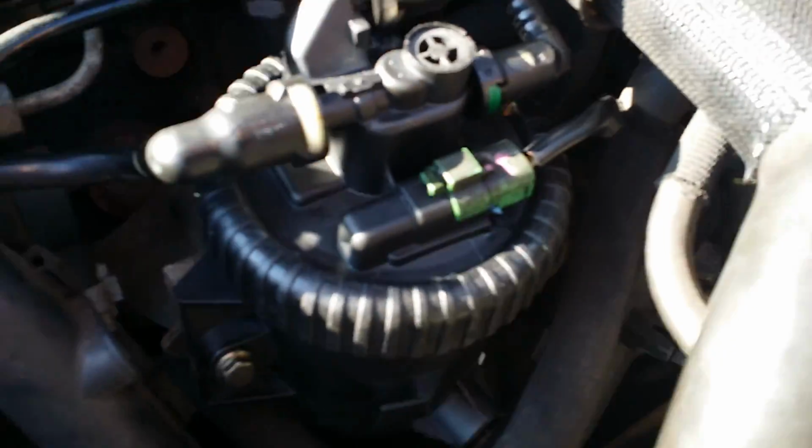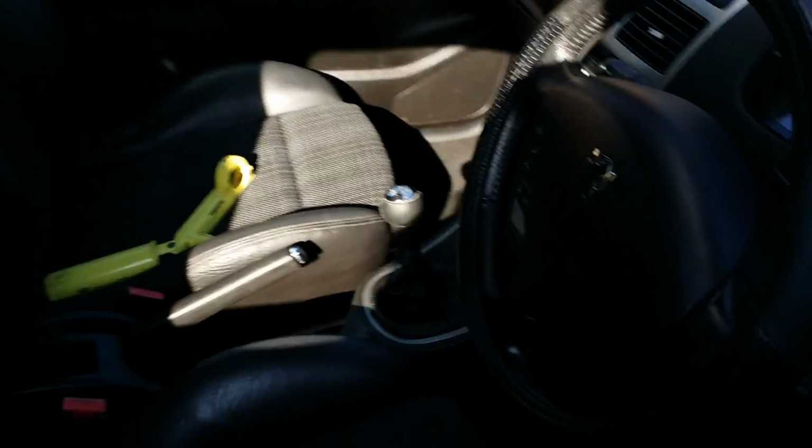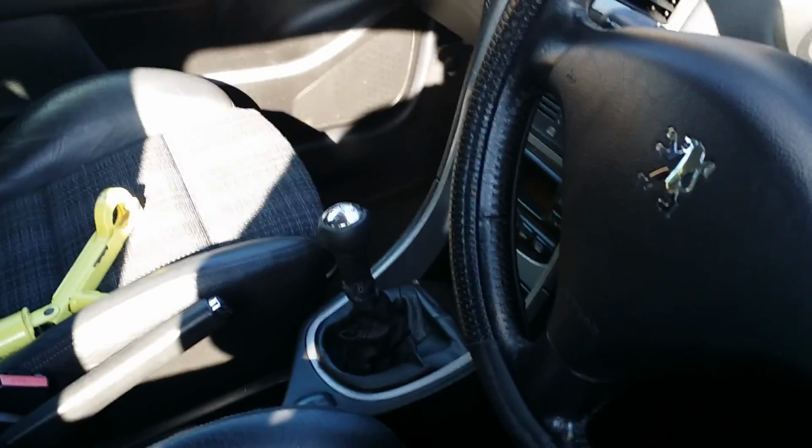Make sure there's no leaks from the pipes that you've connected back on, and you should be okay to go from there. So I can't see any leaks. So there you have it. A fuel filter housing change on a Peugeot 307 2 litre HDI 110. Thanks for watching.